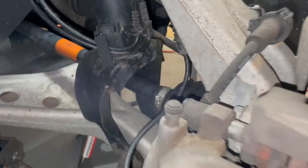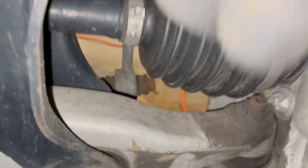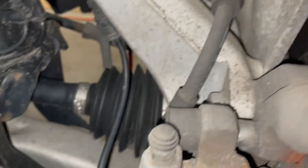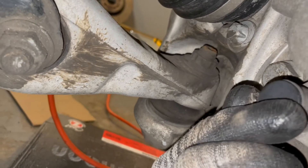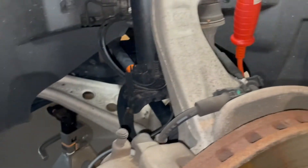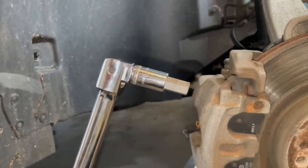Now let me walk you to the back. You'll see two caps — one here and one down here. Just pop these off with a screwdriver. Inside you'll see two bolts, and they're going to be 11mm hex. Just unscrew those and take them out. It's easy to use an 11mm hex on a small breaker bar, just to give it that little torque you need.